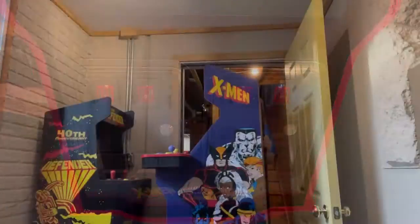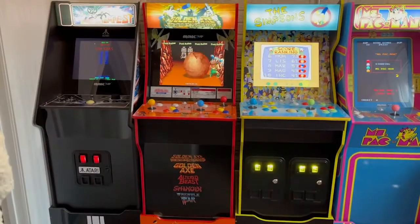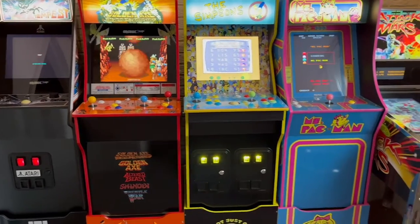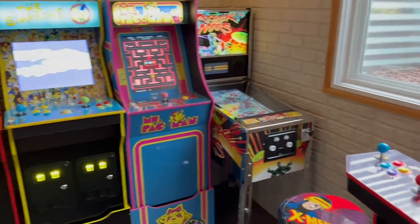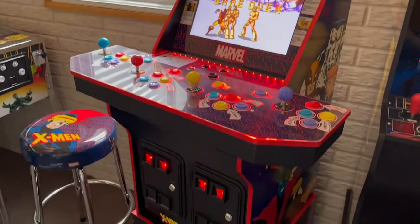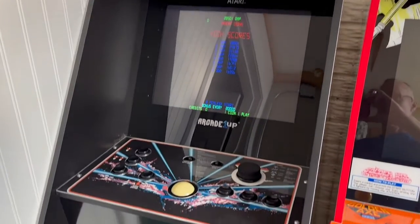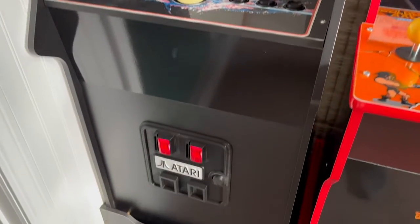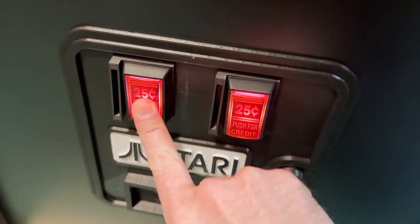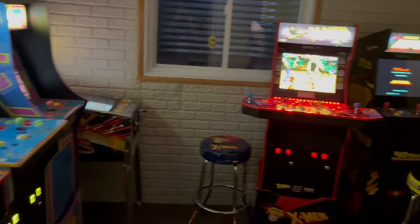I then replaced the back panel and wheeled X-Men from my workshop into the arcade. This was an easy modification requiring just a few basic tools and a drill with a 3/8-inch bit. It took about 45 minutes for me to complete it. I really like how the red LEDs look with the translucent buttons on my X-Men game. And while this mod is not quite as cool as the working buttons I installed on my Tempest machine, I'm glad I did it. It definitely adds a lot to the look and the feel of my arcade, particularly at night.